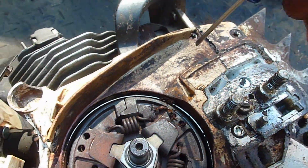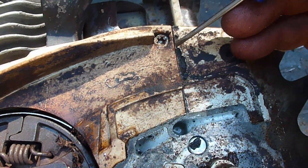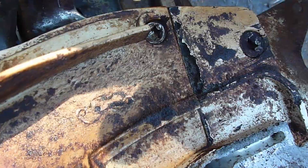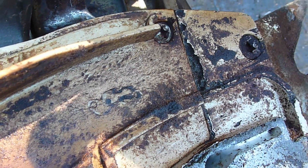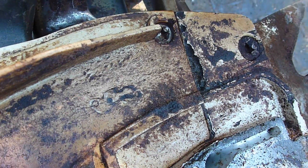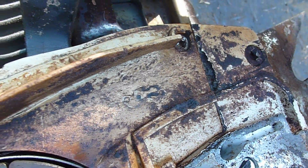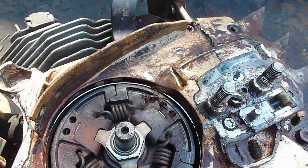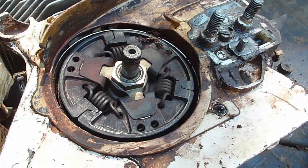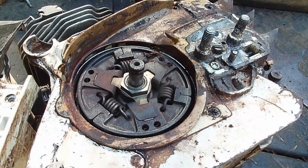But now there's a bunch of plant material right here. So what I'm going to do is take off this plastic cover. You can see right here the saw is all eroded. That's what happens when saws are used to trim palm trees and then they're not cleaned up afterwards. The acids in the palm trees eat the saws, and it is the death of saws where I'm at because there is a lot of palm tree work done here. That's probably what these fibers are, so we'll get that cover off and do more cleaning.